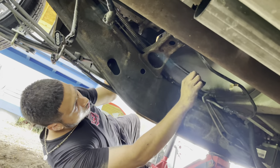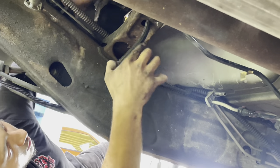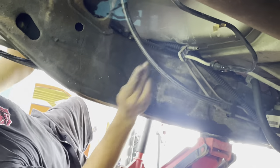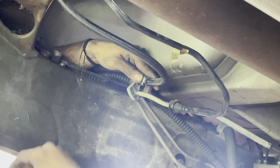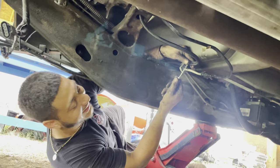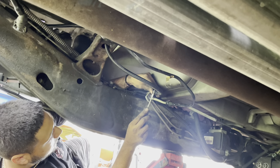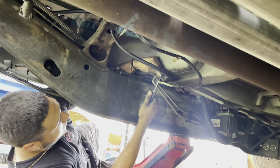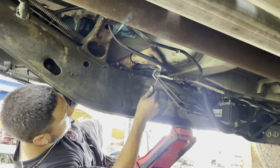There goes the hose that Gilmore was talking about that we're gonna run through the top and through the bottom. You see the little clamp over there that we bought? Just push it in — it goes in and you just gotta tighten it. Make sure you tighten it because if not it's gonna fall off. Now you want to go with braided so that way it's better than the regular hose — so if it does rub, it won't cut your hose.